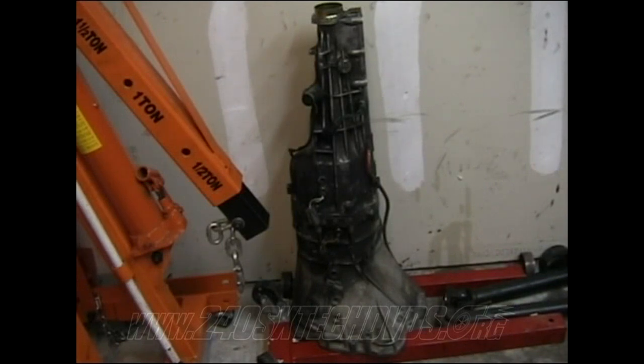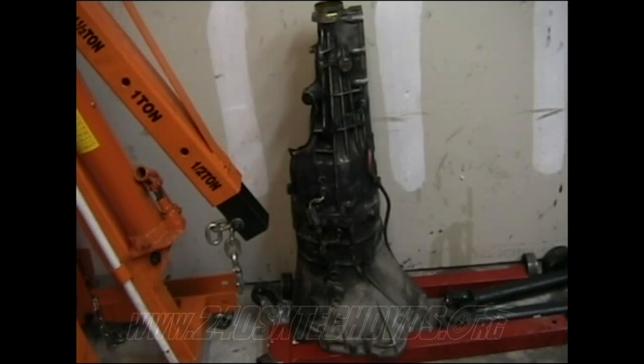And showing you here is the S13 transmission. Basically, it's the same deal with that. You need to go through your ECU factory service manual if you're wanting to hook up your sensor there. And when you're going to wire up your plugs, you need to try and keep the color coordinated or keep up with what it is. Basically, I used a blue wire for my fifth position to the ECU because it has a blue stripe on it, because I couldn't find the yellow wire at the time. And then on my neutral, it's the green with the orange wire. I used the green wire for that to extend the pigtail to the ECU.